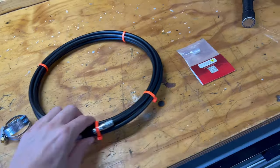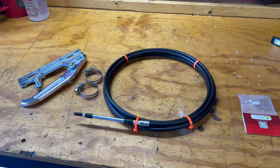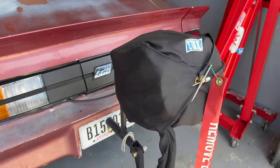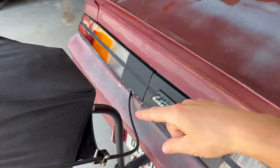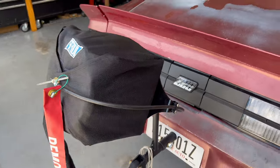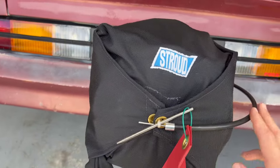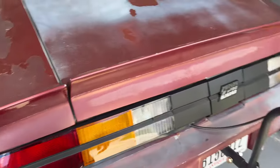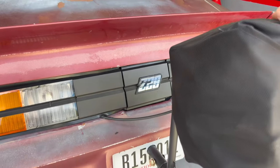We're going to get the parachute handle and cable cut to length and run through the car. We ran the cable from the driver's side all the way back to the cage through the trunk — that's why it wants to come toward the passenger side, which actually works in our favor. It also leaves a little extra length; if we change the handle position we've got about a foot of extra. The Applied Racing mount came out pretty good, and luckily the idea worked well.